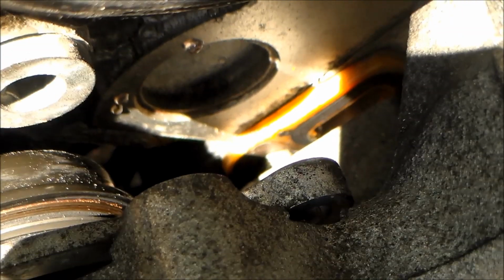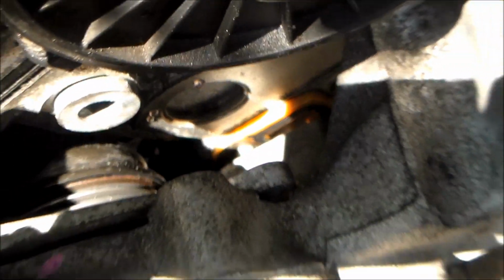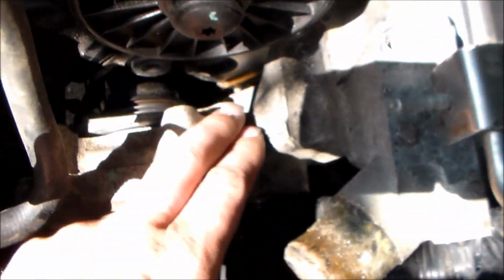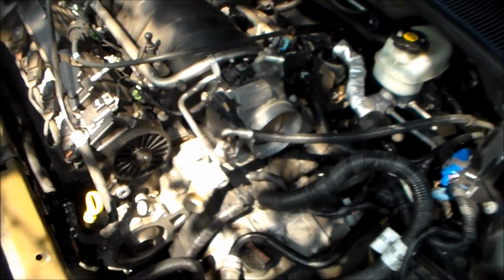way down in there, these little gaskets there, and these little gaskets down in there. They call this part the crossover pipe. So every point where the crossover pipe goes to the head, it's got one of them little gaskets, and yeah, you should probably pick them up on the way to the parts store. Don't be like I did and buy the water pump and all the other stuff and think it's like the old Northstar where you just twist it out of center. But yeah, you're gonna need those gaskets, because otherwise it's gonna leak and you're gonna be doing this again and it's gonna suck.